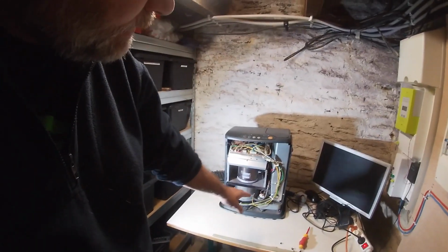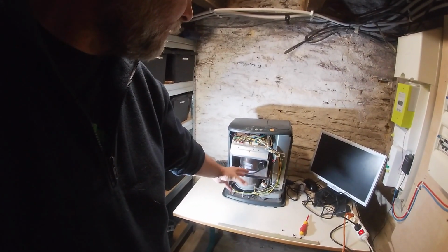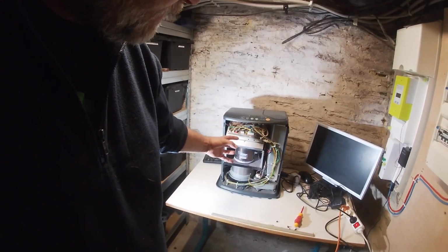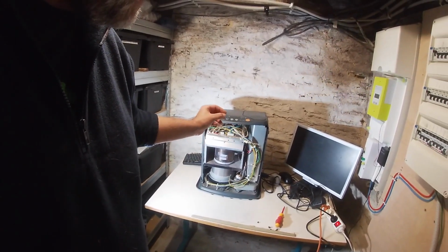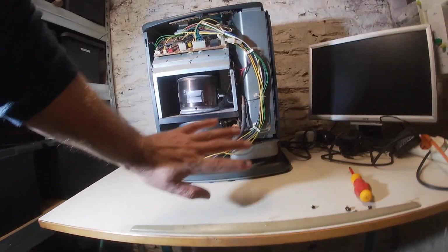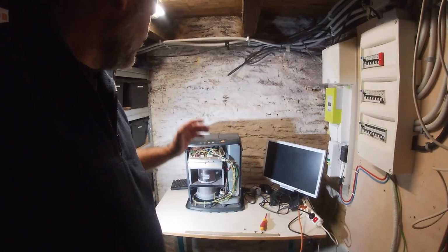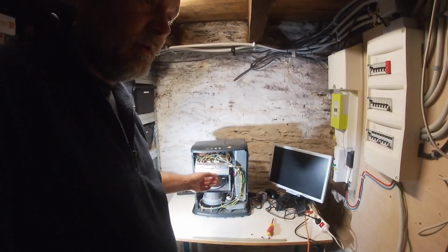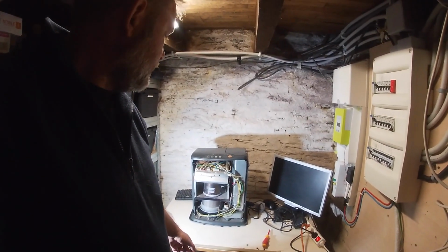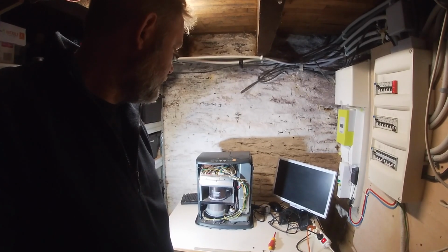Okay, so the startup sequence, the pumps, there's a preheat glow plug in there, then a pump starts when it gets to the right temperature, then the fan at the back there starts, and then it ignites it with this igniter in the side, and you can't see it but it is super warm now, so it's blowing hot air straight out. So I'm going to leave it running for 10 minutes because it would easily have, well, you just saw it before. Make sure it doesn't stop or there's problems, and that's it.